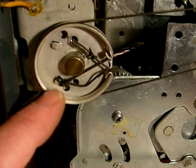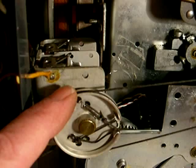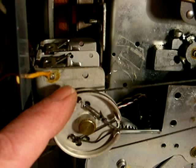Come out of there directly up over the top, one half around, two and a half times out of there, around here, around the top of the drum. Then into the open slot, cross over, and hook into there. That's it. And that's restringing the dial on the Aristocrat Dial-O-Matic Home Record Player radio.